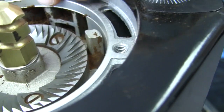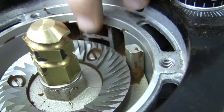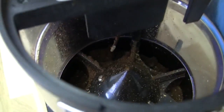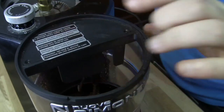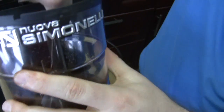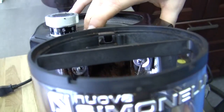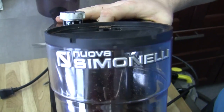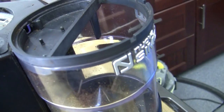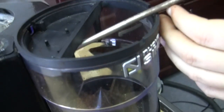I'm going to show you a little more in depth coming in from this side over here. In this grinder here — there are three screws I went ahead and took out because they're a little hard to do. You can see there's a little flap — get your hand under there and just push that flap up; that'll come right out. From there, can you see these two screws right there? You can go through the middle here — even though it doesn't look like it, it's accessible from a screwdriver. If you get a long screwdriver like this, you can actually get in there.